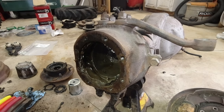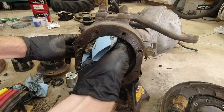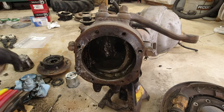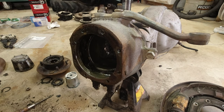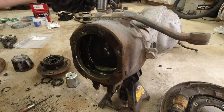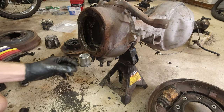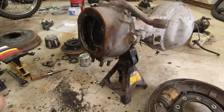There should be a flat spot somewhere — yep, flat spot's there, so we should be able to pull this off. There we go — the short side axle. That looks like it's in really good condition so we'll definitely be saving that. This is probably one of the messiest jobs you can do — there is just so much grease and oil. We still have to take off the top and bottom bearing joint things for the steering. I'll zip the bolts off with the impact.